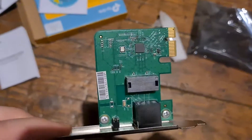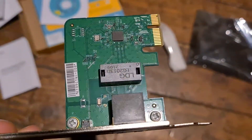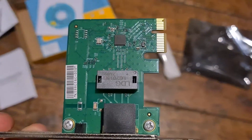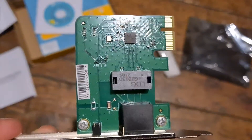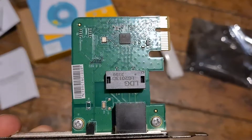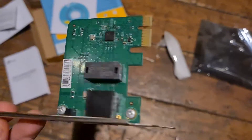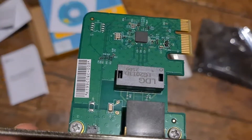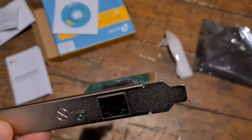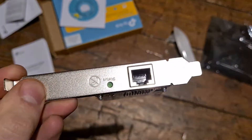Because it is so small and cheap, it has some drawbacks — supposedly it doesn't have a lot of caching or things that offload typical packet processing from the main CPU. This little card with very little buffer or cache will bother the CPU a bit more, but it's irrelevant since I'm using a modern CPU and this is just a one gigabit card anyway, so there won't be huge bandwidth. Overall it's just a cheap card and it should work in Linux out of the box, or at least without much hassle.